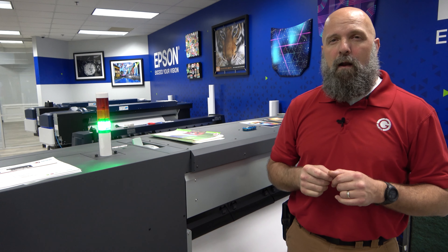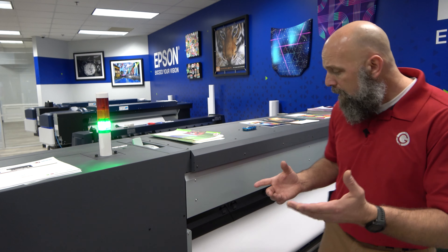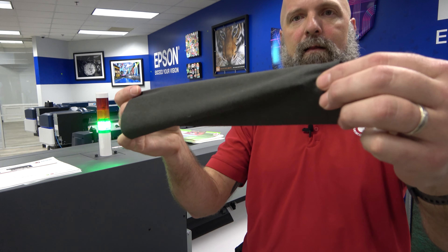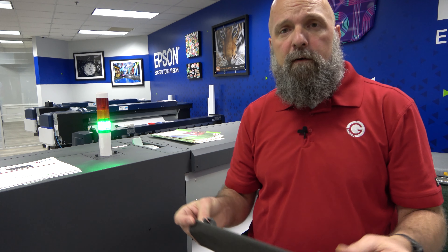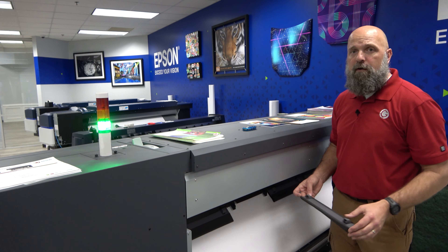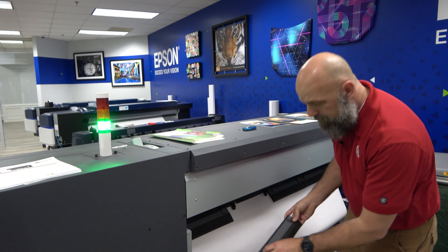The thing I wanted to share with you today is an often overlooked component of the release of this new machine — something Epson has never had on any of their machines in the past. They added these small little wiper bars on the back side of the machine. It's just a plastic strip with some Tyvek-like material that's going to catch any random debris that winds up on my material. Nobody works in a clean room environment. There's dust and debris constantly floating around in the air, and if it were to land on my print and travel into my print zone it could potentially ruin the print. So if a random beard hair winds up falling on my material, this fabric wiper is going to catch it before it heads into my print zone.